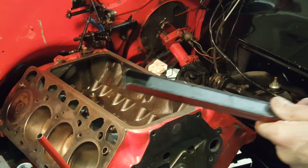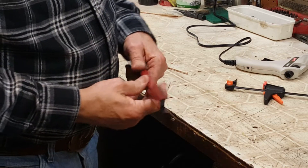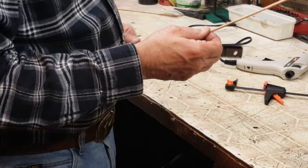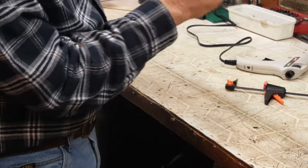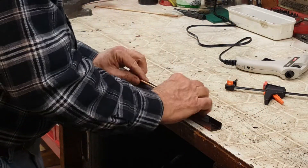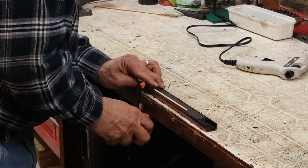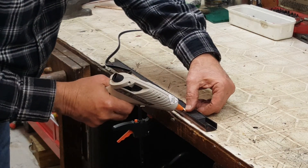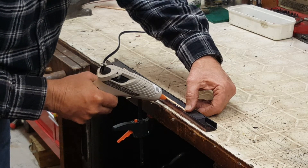So I'm taking this — come with me over to the workbench. What I want to do is have that lifter pull up a little bit more. When this is on the engine it's in this position, so I want to put a little lip on here. I found a 3/16-inch dowel and I'm just going to glue that on here on each side, so I'll gain enough height to pull that lifter up all the way. I'll just put it on with a hot glue gun. I'm going to do both sides of this and the other one, so I'm going to cut the video now and I'll come back when I'm done.